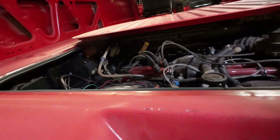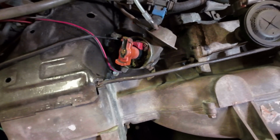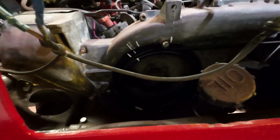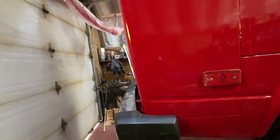Yeah, I wonder whatever happened to that thing. Oh well, I guess things don't last very long. Anyhow, that's pointing towards cylinder number 2, which is the one I have to change. And it's at top dead center for cylinder number two, based on these marks here, which is good. Then I'll get the part and put it on there, and then we'll adjust it.